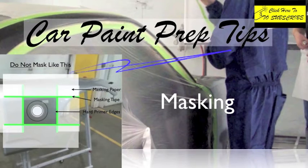Now another method for doing that is just to mask off adjacent panels and moldings. But like for that area, just turn your pressure down, make a smaller pattern, and don't mask anything. If it's not necessary to mask it, I kind of leave it open, and that way your primer will kind of feather itself out.